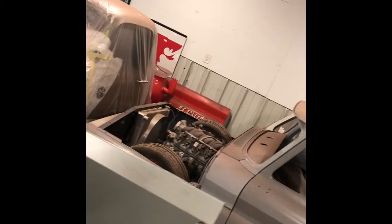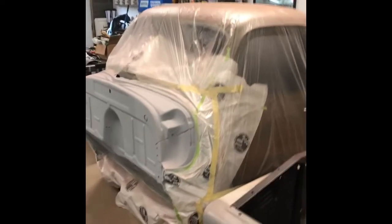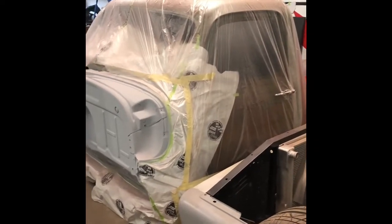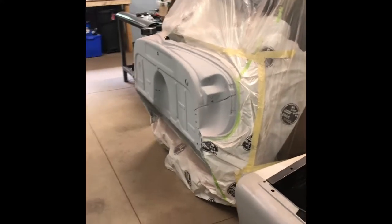I just started putting these Altman latches from Trick Manufacturing in here. Normally they bolt in but I'm welding these ones in — they work a lot better than the factory latches. The C10 that I posted in one of my old videos, I haven't really done much on. I started smoothing the bed, just started smoothing the inside of the bed so it's just in there with Clecos right now. And there's a 54 Chevy cab — it's all patina so we're gonna leave the outside of the body patina, and then the firewall and the whole inside is gonna be painted Wimbledon white.